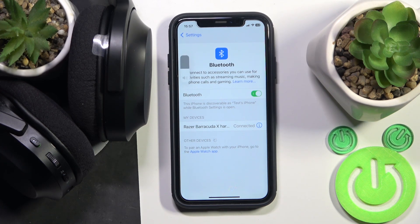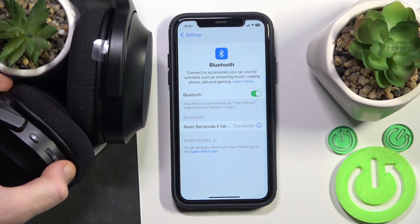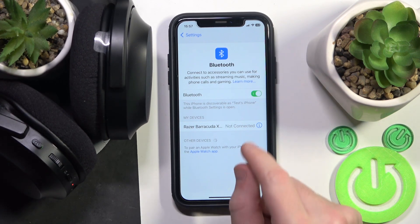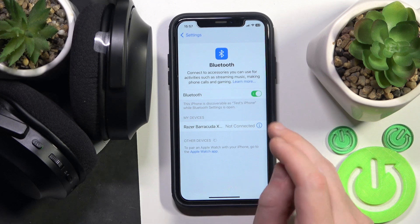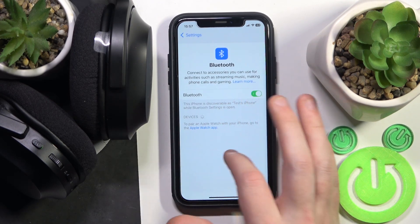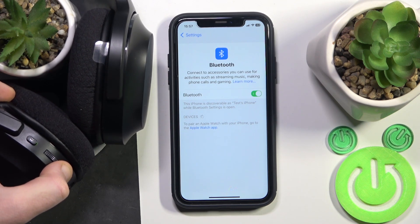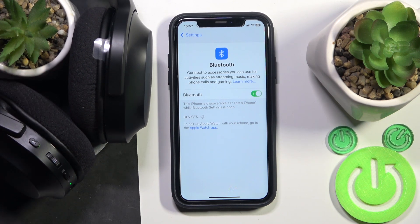But if it also didn't help you, we should remove and add the headphones. So I recommend turning off your headphones. Now click the information icon, or the settings icon if you have Android. Forget this device — forget device. Also, if you have Android, don't forget to click pair new device. After that, press and hold the power button to turn it on. Now we should enter pairing mode automatically, but if it doesn't, just press and hold it for five seconds when you're trying to turn it on. And now click on it in the device list.